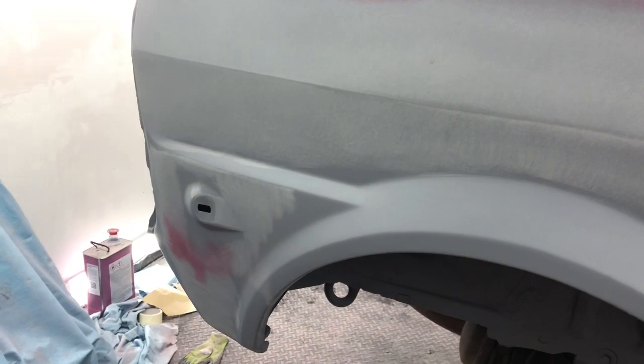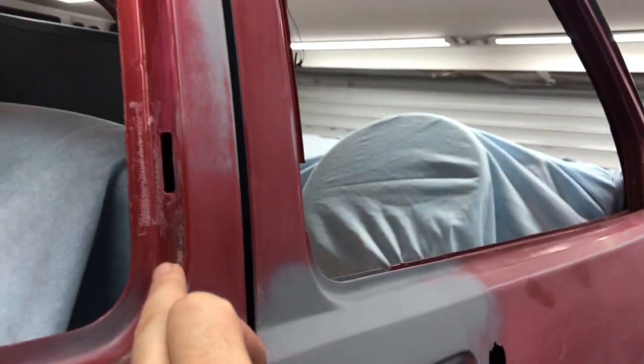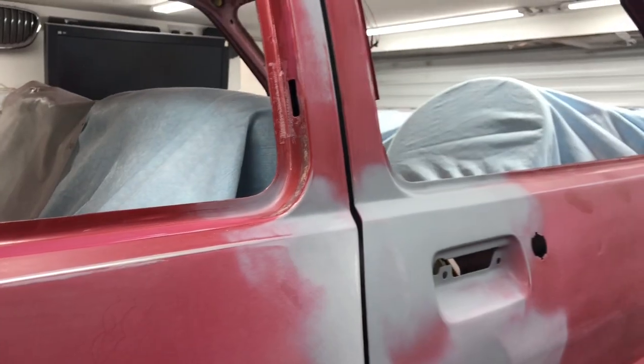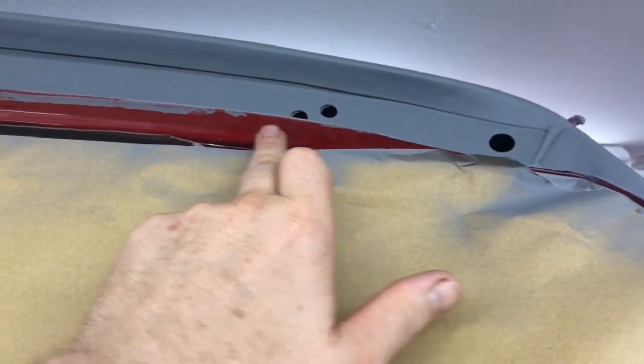I think what I'll do is put it on a time-lapse and start scotching some bits of the car, because I just need to start rubbing all that back. The roof's just about done — it's just ready for some high build. There's a bit of overspray just from the etch primer which I'll clean off with some thinners, because I don't really want to repaint there.